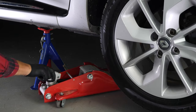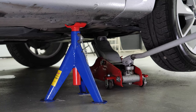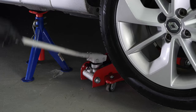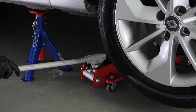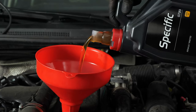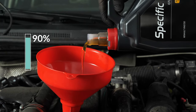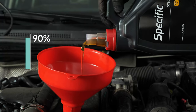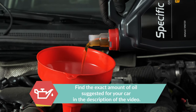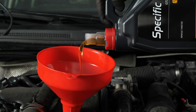Now you have to put the oil back into the motor. You have to be very careful and precise when doing this part of the job. First, put the crankcase back in place, then lower your car back on the ground and check the oil level — this can only be done when the vehicle is flat. Add the oil into the engine, beginning with 90% of the suggested amount. This will leave you a large enough margin to adjust the level appropriately. You can find the exact amount of oil suggested for your car in the description of the tutorial.